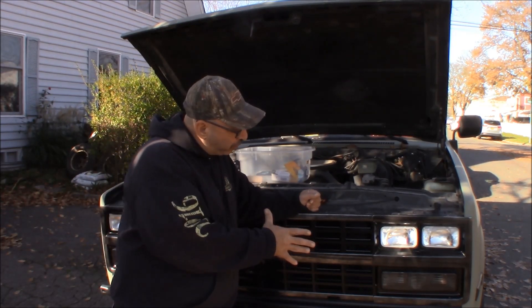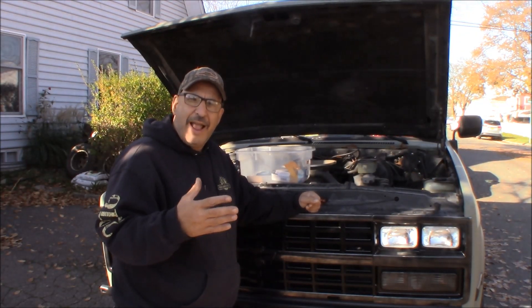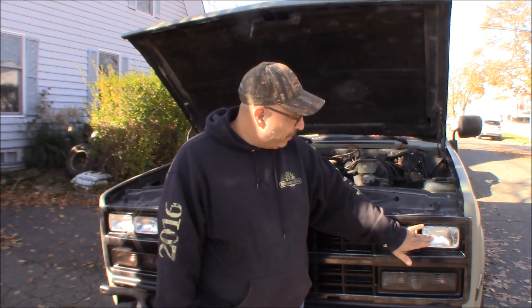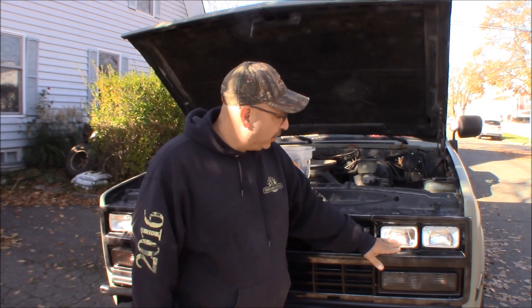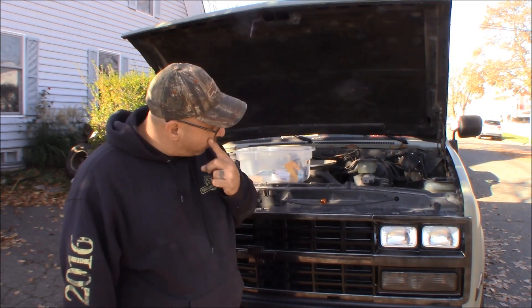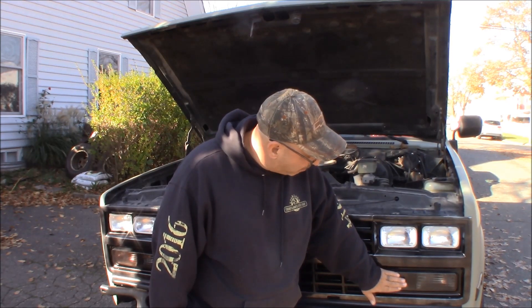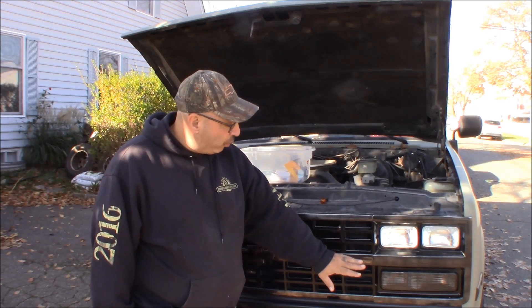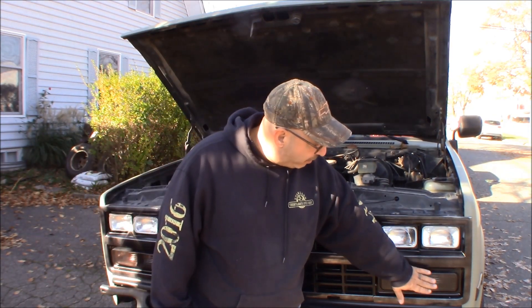In a previous video we were putting the grill together on this. We tried LED lights and had a little trouble. The small rectangular headlights are not available in DOT-certified LEDs, so we went with the brightest Sylvania halogen bulbs we could get. In the parking lights we have what's usually an amber marker and an amber directional, and we changed out that amber marker to a white LED marker — it gives it a neat look.